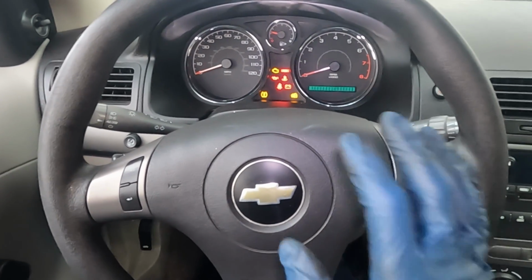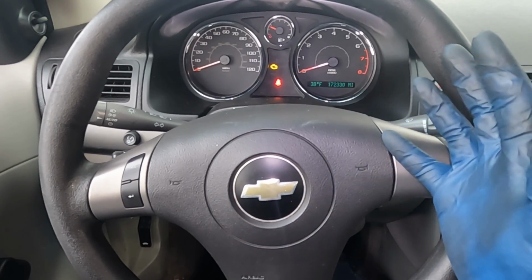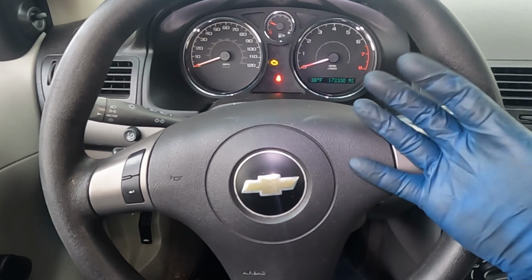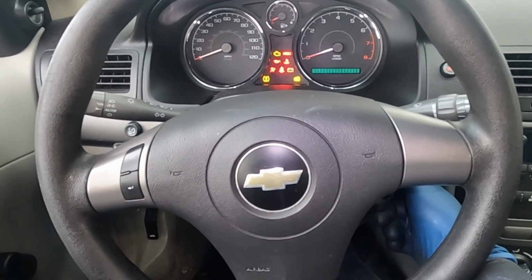And what we're doing is we're priming the oil pump, priming the head, getting that oil all circulated before the RPMs go up to about 1,000. Usually when it starts cold, you're around 1,000 RPM. Cranking is around 200-300 RPM. So we're getting that oil circulated at a lower RPM. Turn it off. We'll do that crank one more time.